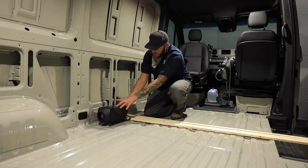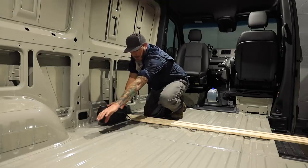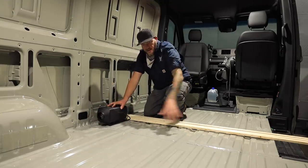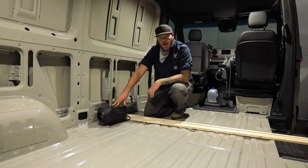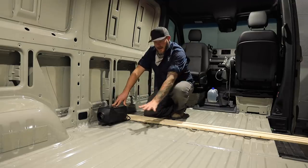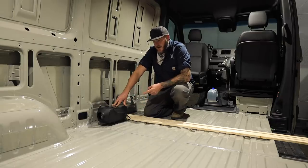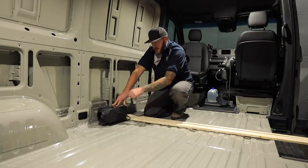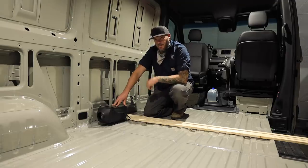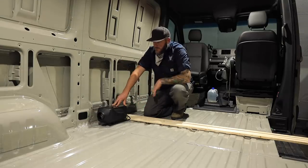The intake will come in this direction, then the hot air will come out, and then I'll do a 90, and so it's exhausted here into this area, which is more centralized here in the van, and I'm hoping that will be more efficient. The great thing about the Sprinter is the fact that it is diesel, and the diesel tank is actually right here. So the auxiliary pickup for the diesel heater is right in this vicinity. So I think this is gonna work really, really well, putting the diesel heater here. And then of course there'll be cabinetry and stuff built around it.